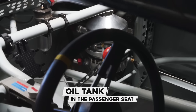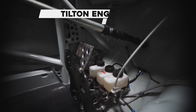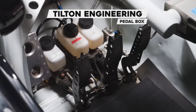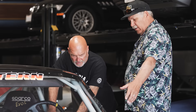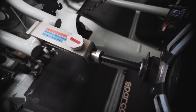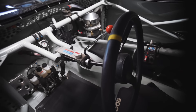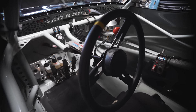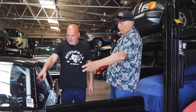All the fancy pedals are on the ground — not mounted from the dash. That's a Tilton engineering pedal box. I can move it from side to side, forward, backward, in different locations. Because sometimes when you're done with a car, it doesn't feel right and you can't change it. The steering wheel moves six inches in and out for different drivers — I made it adjustable with an L-bracket so I can slide it.